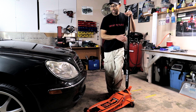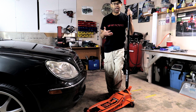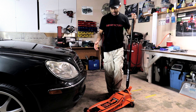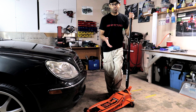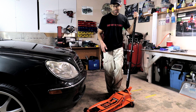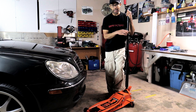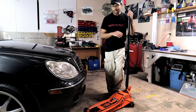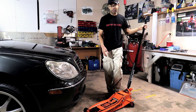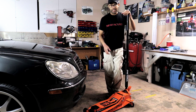And then after that, you could see that when I was lifting the car, there was no more dead space. So when you get your jack, I advise that you play around with the fluid just to get it to the way that you won't have any dead space when using the jack to lift a car. So play around with the fluid, get it just right to the way you want it, get all the air out, and then you're not going to have that problem of it lifting up when it's open. It'll be fine, and then it lowers just as smooth, so it's great.